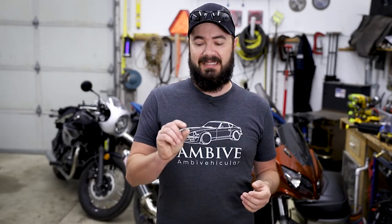There you have it. As you saw, the lifter noise is pretty much gone. This car is far quieter than any other NA Miatas that I've heard, and it's due to both the new lifters. The old lifters had some discoloration, so they definitely were a problem. My guess would be somebody installed new lifters, didn't make sure they were freed up, just threw them in there hoping the oil pressure would free them up, and it didn't on all of them.